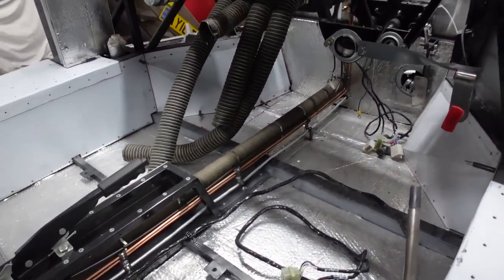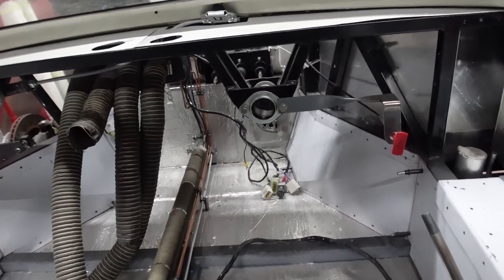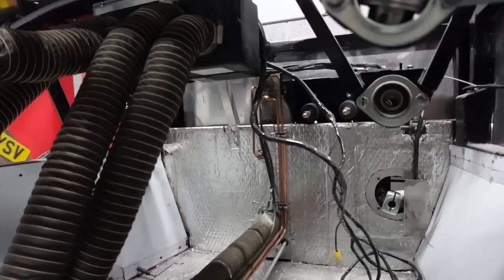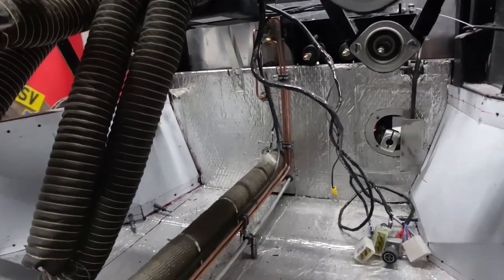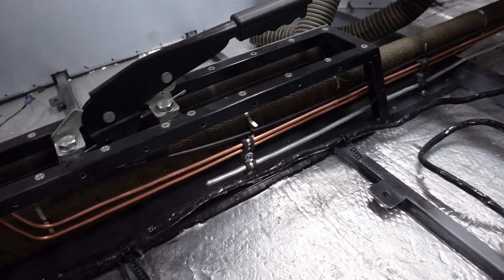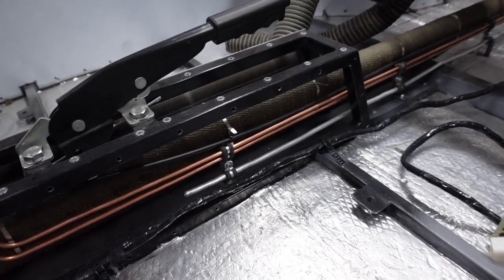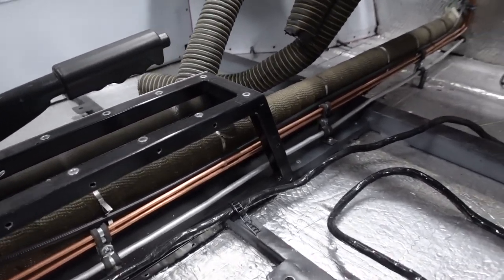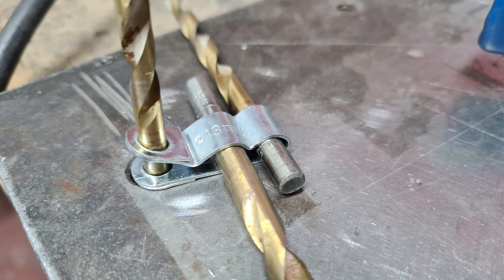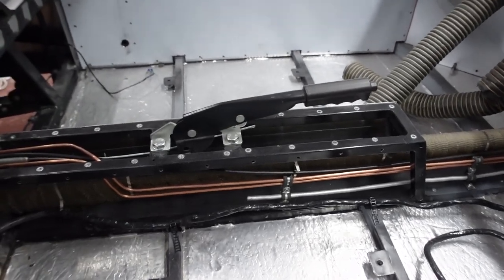Because so many items have been moved around, I've had to cut back or extend the loom to suit — just a knock-on job really. Coming through into the cabin, I decided to run the hard lines in the coolant pipe tunnel. Those following from the start may recall the hard lines were previously run down the driver's side outer sill, which I never liked the look of. So I fabricated up new hard lines to follow the route I wanted, and made up some bracketry fixed to the chassis to allow P-clips — which I've modified to act as hard line separators.